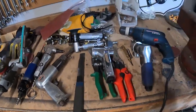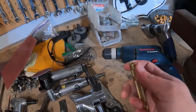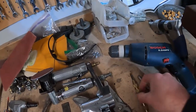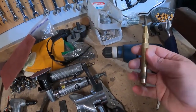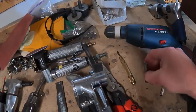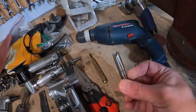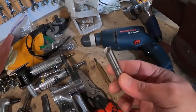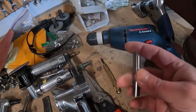Speaking of spot welds, get yourself a good center punch. I like the spring-loaded version — you can set the tension on how hard you want to leave your indentation for the drill bit. That's a hand-me-down from my dad, but you can still find them at Lowe's, Home Depot, or Amazon for about $10. For spot weld cutters, I bought one from Eastwood for about $40 to $50 — it was really sharp for the first hundred or so spot welds, but then I didn't use enough oil and dulled the tip.